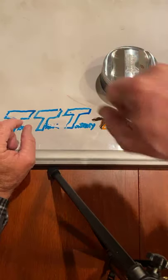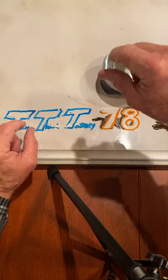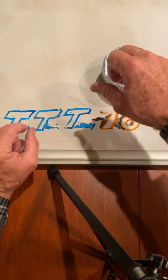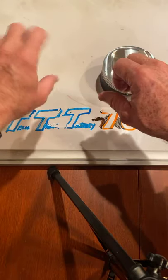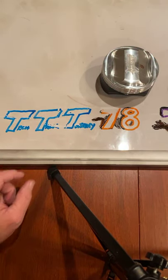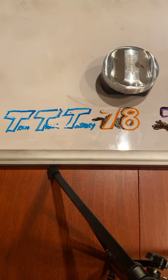Now you've got to put in some kind of really big clutch plate, some kind of heavy spring, some kind of lockup to fix the problem you created by going to the small gear here. If you do that, now you're going to break something for real because you've taken your fuse out of the picture, which is your clutch.